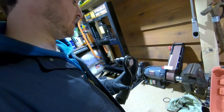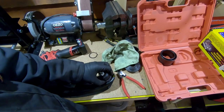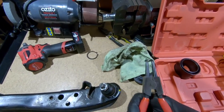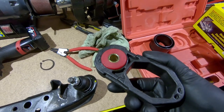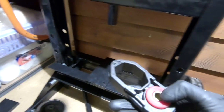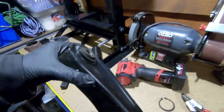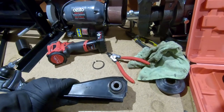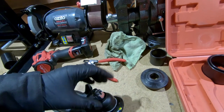Today I'm doing my ball joints. I did try to give them a go on the press, but it was a bit shaky and unstable — I didn't want to launch stuff everywhere. Getting these to go in completely level is a bit of a bitch. So I am starting them on the press and then finishing them with the hand tool. This tool is pretty bad, so I'm thinking surely there's better ones out there. I pressed in my first poly bushing, but it's so incredibly big that I couldn't get it to go in evenly — being poly, it squished in and then it all just went fling. So I'm learning.